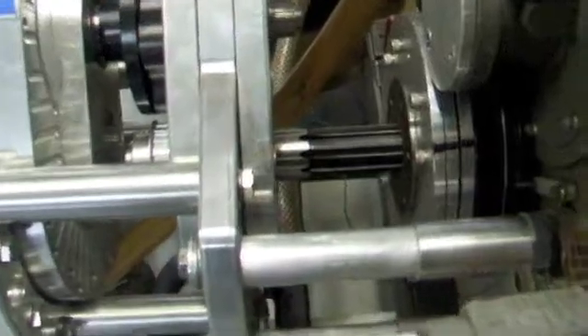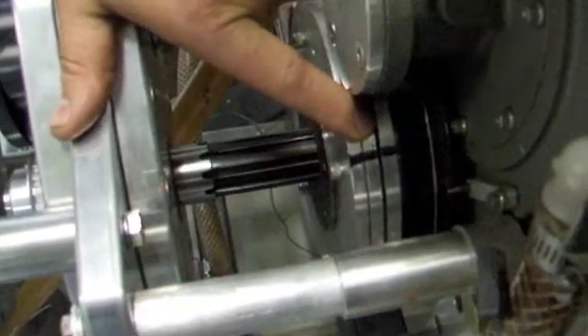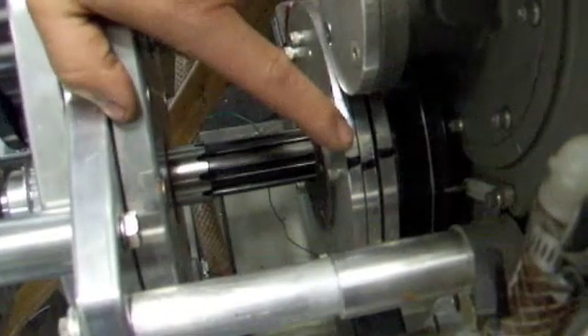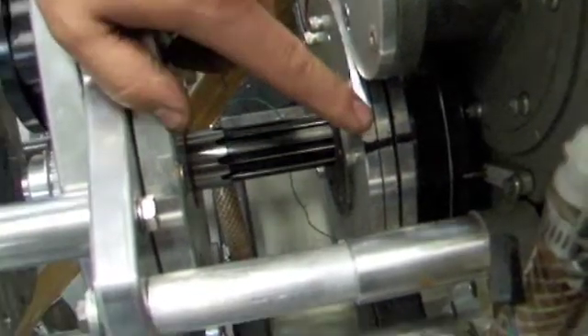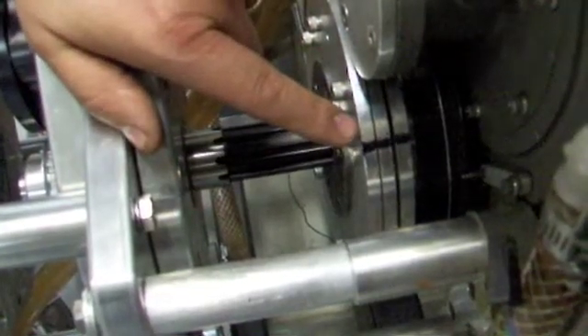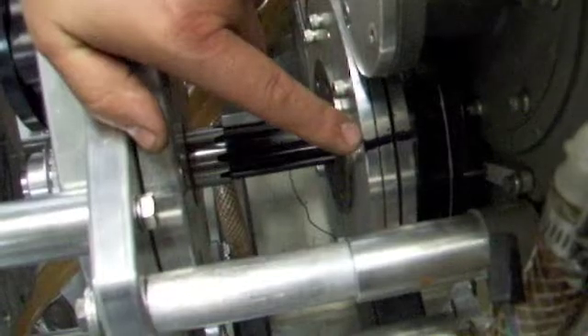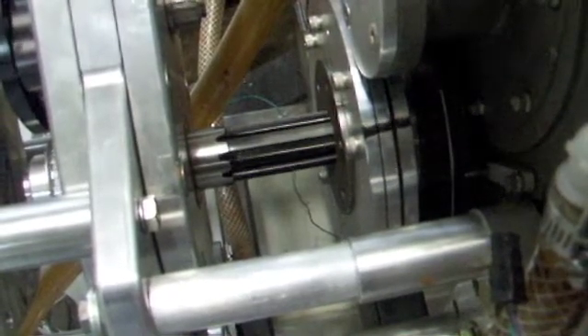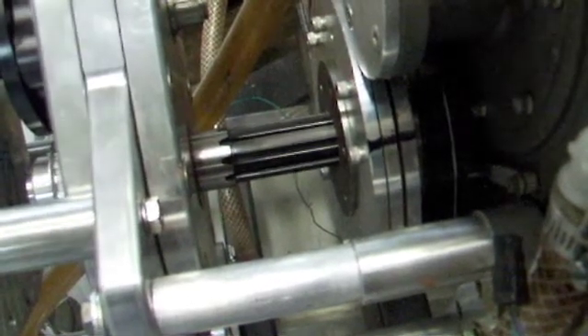Take a look here — I'm actually turning the inlet of the supercharger. I've got my hand inside there, and you can see that the shaft rides on a floating center plate. Notice that as I'm turning the blower, we can make this go to a mechanical stop of torsional dampening on both sides of zero — a total of 15 degrees. As I'm turning the inlet, the impeller of this F3, you can see that it is absorbing both sides. That center plate can absorb and not transmit the harmonics through the shaft, and hence into the gear drive and the blower.